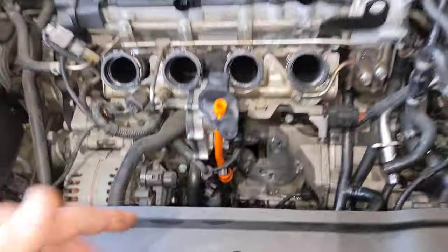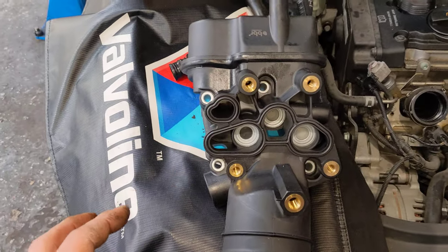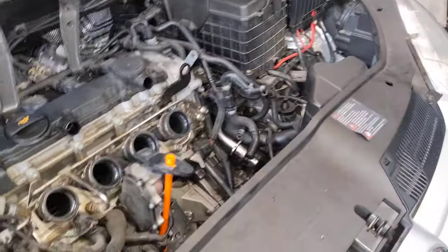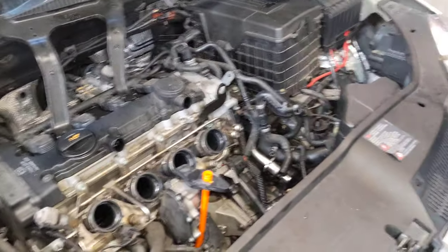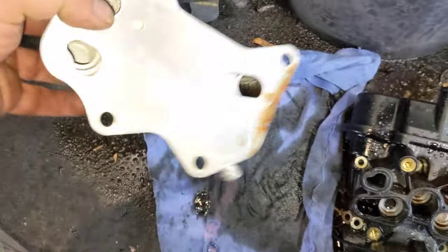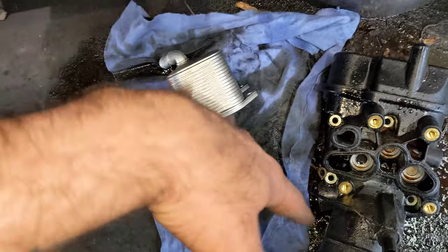It's quite tedious as there's a lot of wiring clipped on here, so you need to lift the car up and down. You need to pull the oil cooler off first. If you've got really high miles, change the oil cooler. This particular car has 80,000 k's, so I've cleaned it up and I'm reusing it, but on the more modern Audis that's a problem.